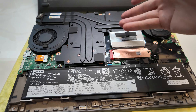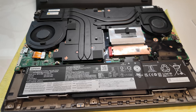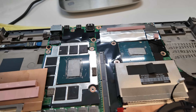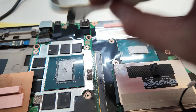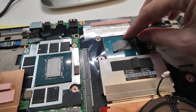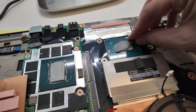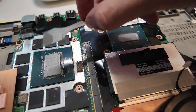I'm going to take these off and show you what it looks like inside, then show you how to apply PTM7950 — it's different than thermal paste. Here's the thermal paste application — just a nice spread. It's paste, right? It stays until it dries out, which is a bad thing. You don't want it to dry out. It'll stay with this semi-thick consistency and eventually dry out and become less effective. With PTM, it's going to harden into a solid material.